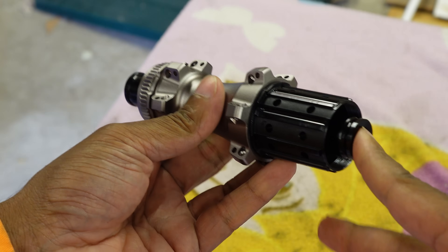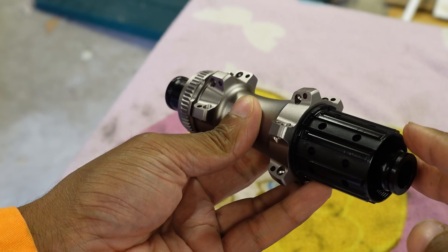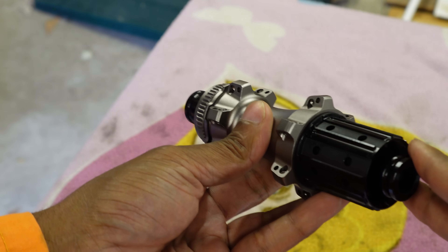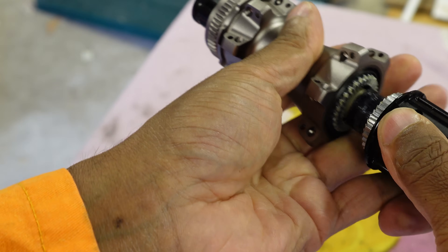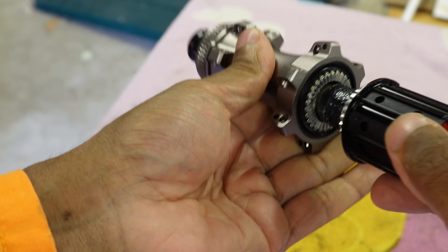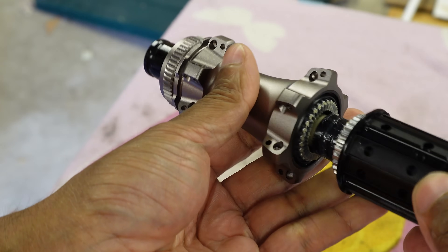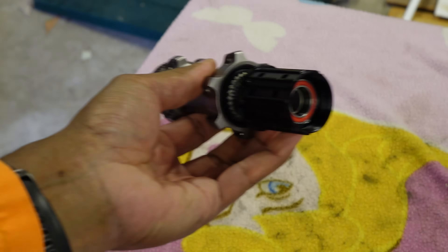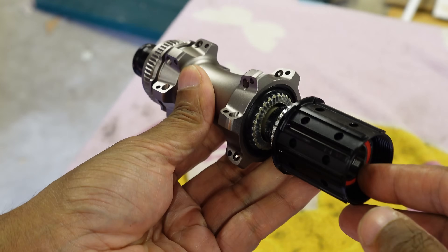I'll use this hub as an example because it's of a similar design. The hub has a 45-tooth ratchet. The odd number is preferential from a vibration perspective because you get less chance of a harmonic. This is the ratchet system — you can undo it, pull it off, and that's how it's set up inside. This is very similar to what DT had not that long ago but the patent ran out. With a normal DT hub you need a special tool to get the bearings out; on this one you don't — you can use a normal press and fish the bearings out.